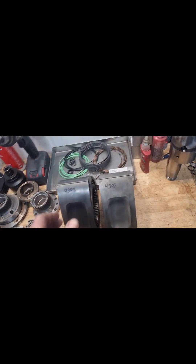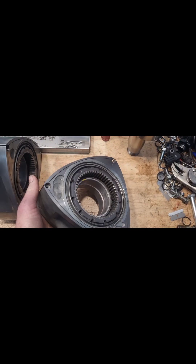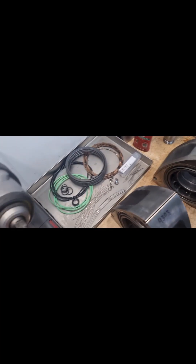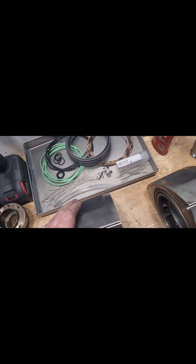What we've done is clearanced the rotor on the side and tip, and we've got a deep groove rotor bearing in it. Everything else in the engine is quite good — as you can imagine, an engine that's only done 7,000 kilometres, the bearings are mint and everything is really in great shape.